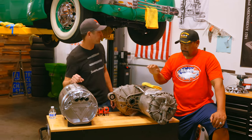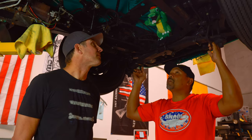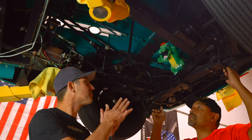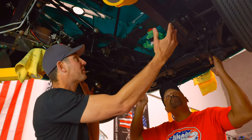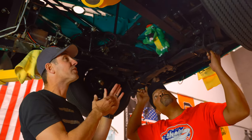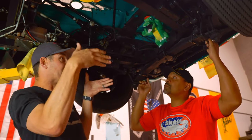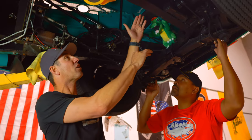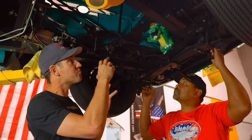Let's take a look at the rest of this vehicle. Eddie B is going to give you a walk-down of the initial design. The motor is going to go somewhere up here — we have about this much room for width. This is exactly why we're using the divorced LDU kit, because we don't have the width to put a full LDU with the inverter mounted on it. The frame rails in this car pinch together towards the front. This vehicle has a very unique look — they call it the coffin front end. You'll see it on tractors too. Everything kind of pinches together with big bubbly fenders, so it's narrow up here in the frame rails.